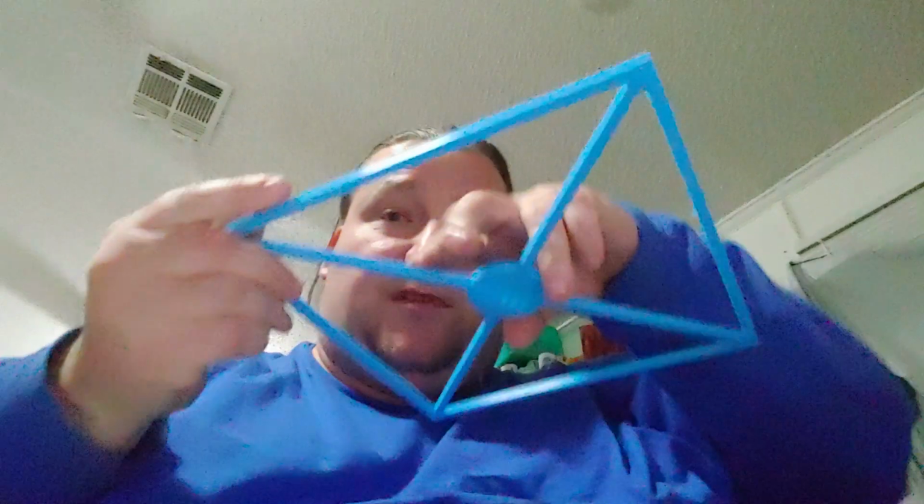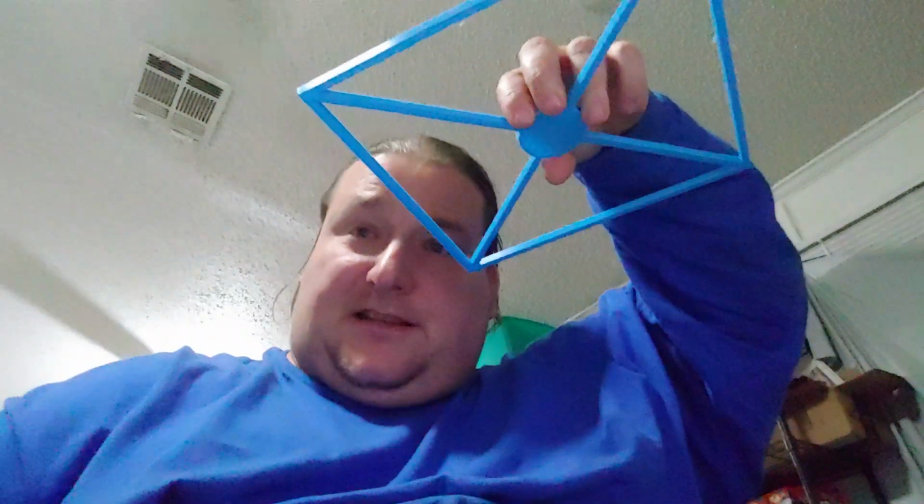But with a Delta printer, you have a set of towers. So this is the top of the printer. And at the top of the printer, you have 3 end stop switches, 1 for each arm. A Delta printer doesn't really have an X, Y, Z. Z is all the motors up or down, but X is a mathematical dance of all 3 motors.